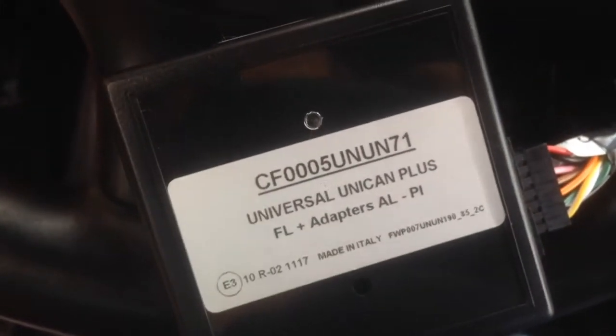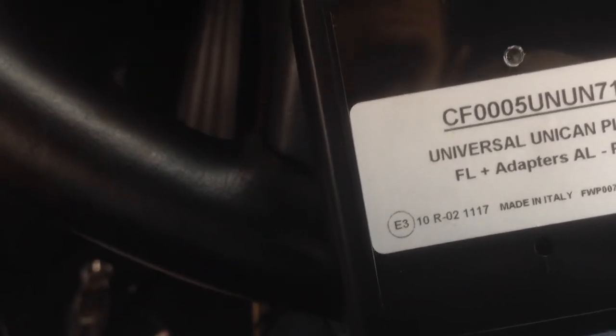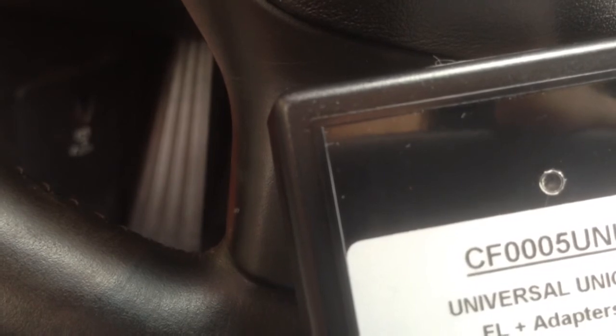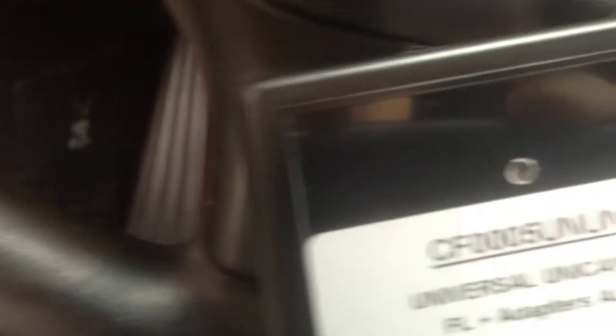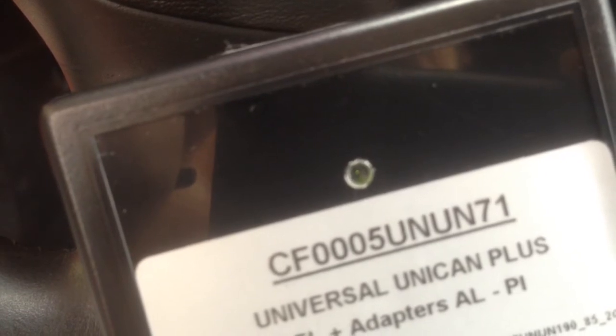Basically what you're doing is you just need to select the Pioneer radio that we're hooking up to it. By doing so you're going to go five clicks volume up on the steering wheel, which is going to give you five flashes as feedback. Then one click back and then one click up on the steering wheel. It's going to give me five flashes and then one up, which will then give you a solid green. Once it is solid green you know you have selected the Pioneer radio — by giving it five clicks up on the volume and one click on the steering wheel. Once it goes solid, you are then programmed.